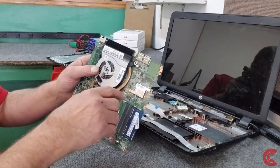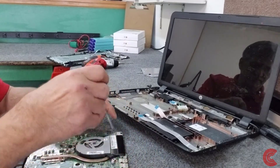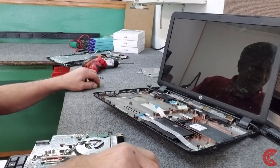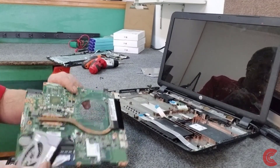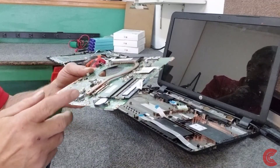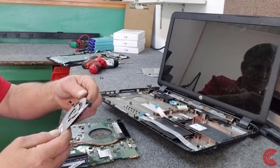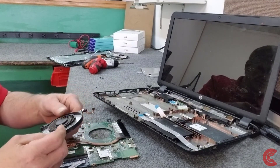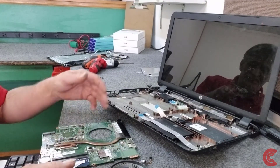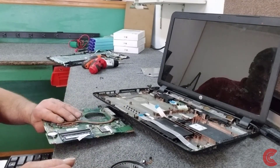On the bottom side of the motherboard we have to unplug the fan connector and there's one screw in the corner to take out. Be careful handling the motherboard because we've got to put it back in. You can see this is completely blocked with crud — I'm going to blow all that out, clean it up, make it look real nice so we get good airflow. I'm going to order a new fan, put it back in basically in reverse. And we won't get that warning on the screen from the BIOS saying the cooling fan is bad. Being careful with your cables, you should have a good cooling AMD HP 17-inch notebook.